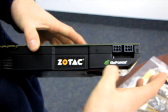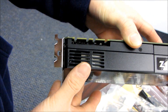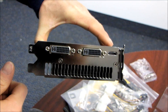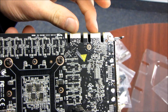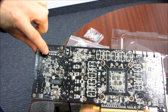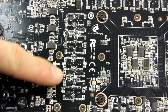On the top of the card you'll find a Zotac sticker, some GeForce branding, and two six-pin PCI-E power connectors. There's also a ventilation hole — so a little bit of air exhausts into your case, but the majority goes out the back through the exhaust vents. We've got two DVI ports and one mini HDMI port, plus two SLI connectors compatible with two-way and three-way SLI. On the back of the board, it's identical in every way to the GTX 580 PCB, including solder points for the extra two pins on the eight-pin power connector and solder points for the extra memory the GTX 580 has.